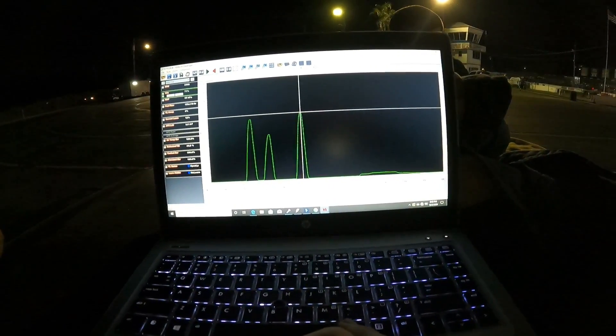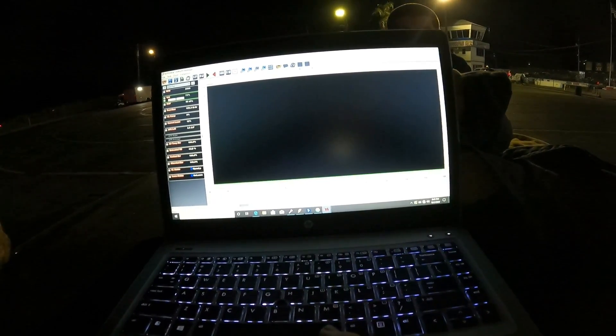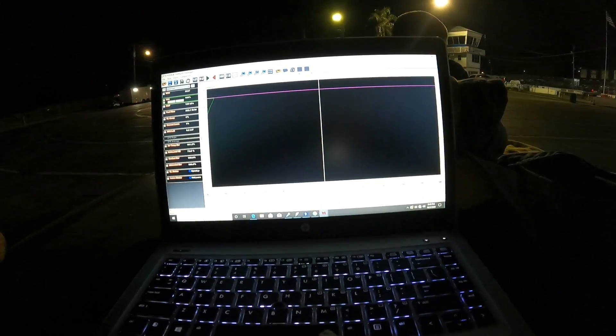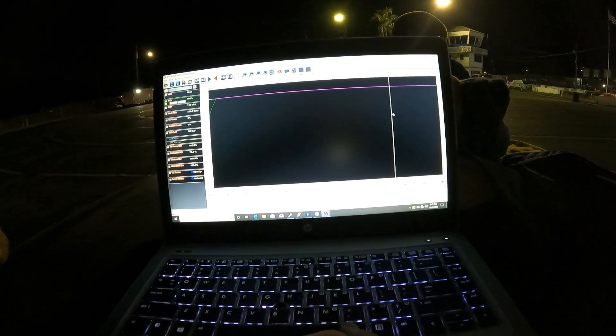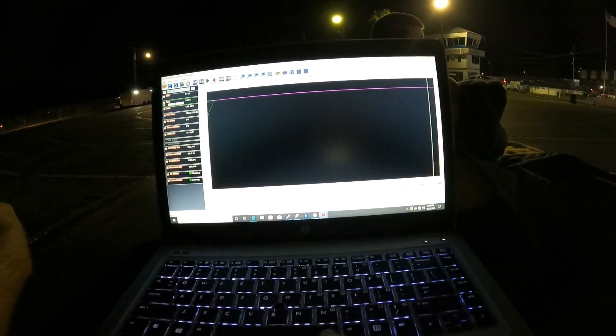No data log again. I guess we'll have to figure that one out. How are you triggering the log? Maybe it's here — I had it go off TPS that time. The first time it was off the trans brake. You're 100% throttle but... I don't know. I need more channels. I only got the TPS selected.